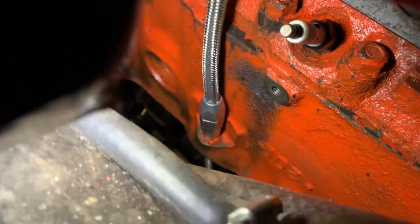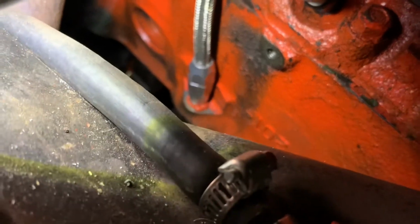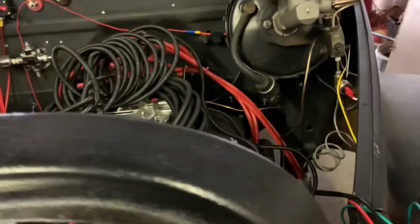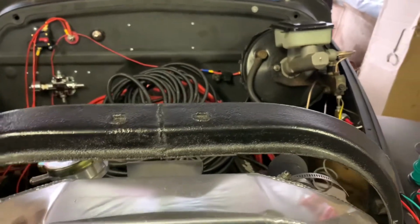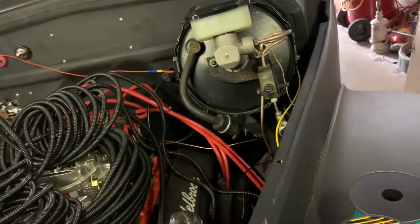This is how I've been working on this. So there, I got it in. You can see the tube coming in where the oil pan will go, and the RTV around the end of it. There were O-rings around that. I decided not to use them because, without taking the fender and the headers and everything off, I didn't think I would be able to get those O-rings to push down in there. So I just used RTV. It's a high temp RTV, it'll be okay. Now I just got it clamped down with the bracket that goes to the header bolt, and just let it dry. So that's down. Now I can put the new oil pan on, clean up the starter and put it back on, and then lower it back down.